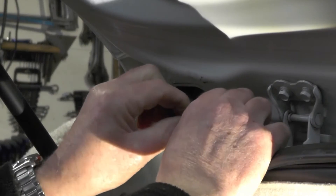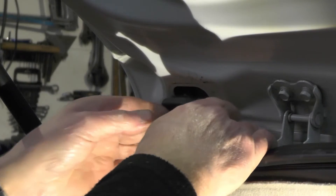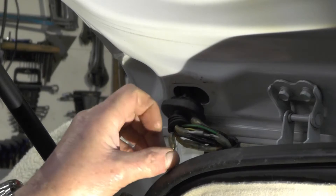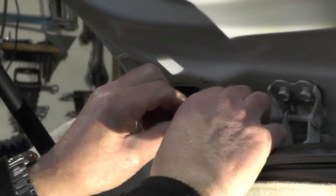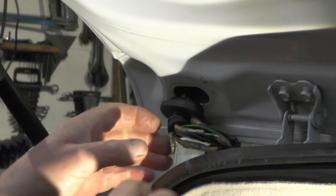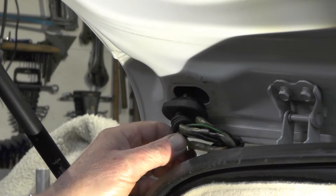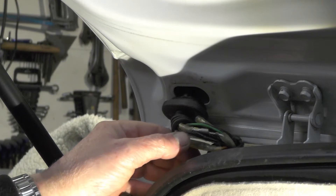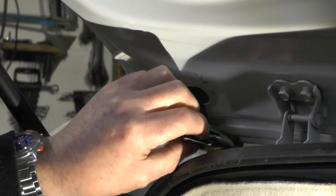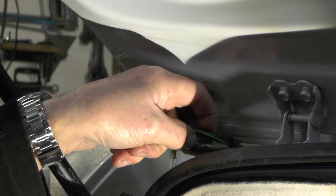What I did back then was a quick repair by putting some connectors in. It's a bit fiddly here because you've not got much room and there's not much wire to spare. I put four connectors in, connected it all back up, insulated the cracked wires, put it back together, and it worked for a year — until I took it for MOT yesterday and found the brake lights weren't working again.